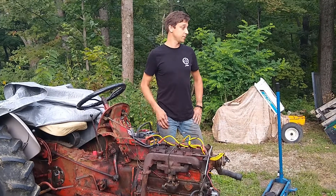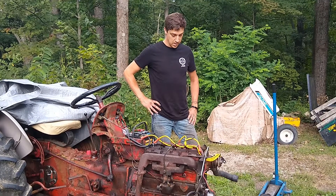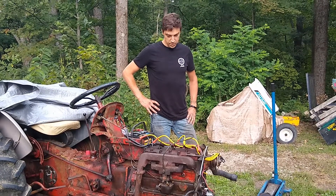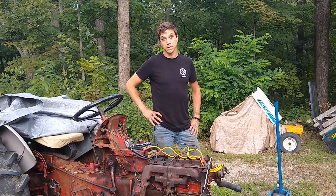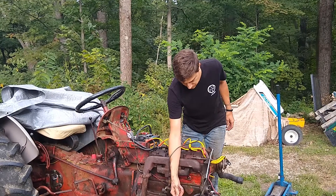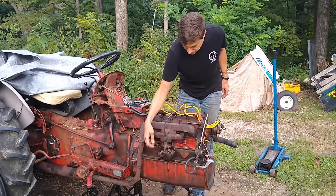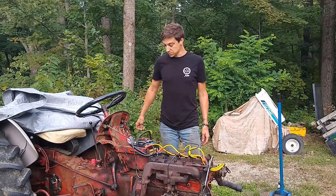We're going to move forward. We're going to put on the timing cover and the cam gear. Not the governor — we don't have the parts yet to put the governor back in. What I'll do is probably just leave the side of the case open here with the drain just like this, and then throw some fuel down in it, put some spark plugs in it, and see what happens.